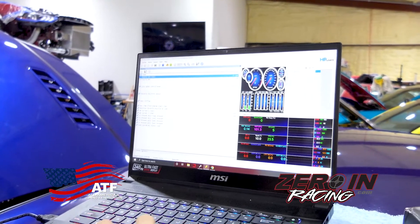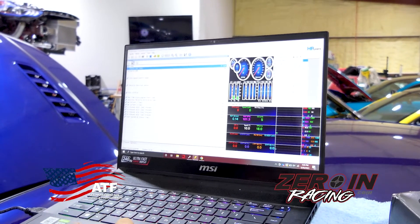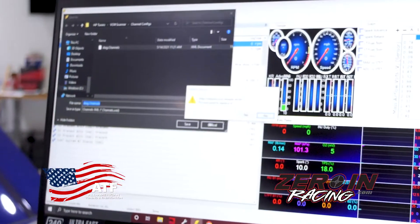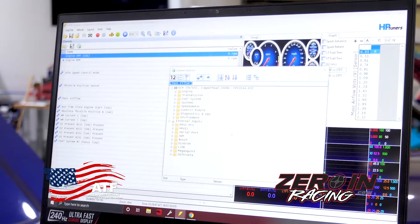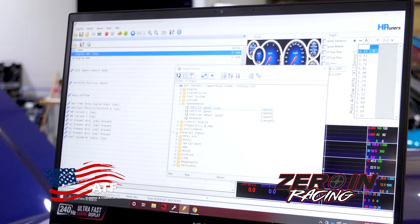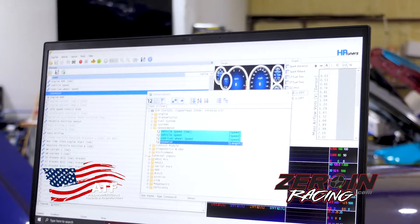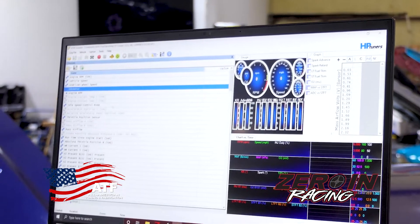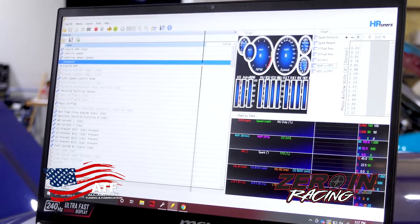You can't actually affect anything with the car using any of this — it's read-only — so you can get in here and play with it, look at whatever you want, create channels. For example, if you're trying to diagnose a speedometer issue and you want to know if wheel speed matches what the computer sees and what the odometer says, you can come in and add all that data. It's a really cool tool if you don't have an actual scanner.